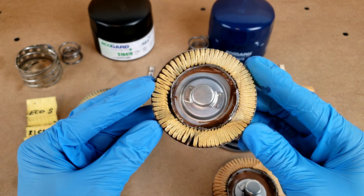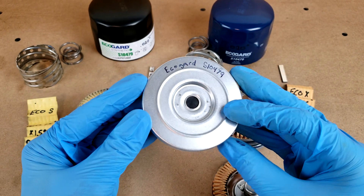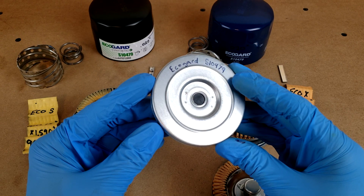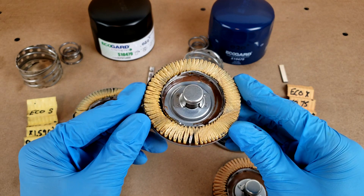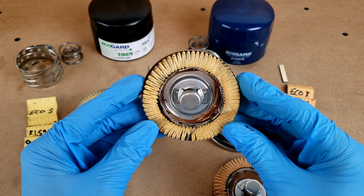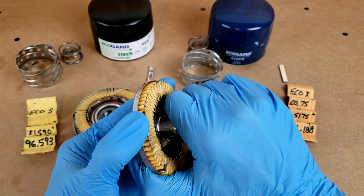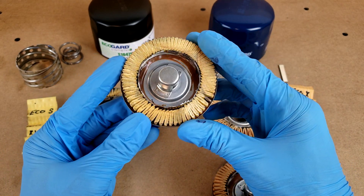The three-piece pressure relief valve is pretty simple — just a stamped piece of sheet metal retaining a coil spring, with what looks like a hard plastic seal on the inside. I've seen some with rubber seals that I like better since rubber conforms best to block leakage, but since the valve is meant to open, a hermetic seal isn't really that important. I like the simplicity and robustness of it — it feels like you could hit it with a hammer and it'd be fine. The only failure mode I could envision is if the tack welds had issues, but this particular filter feels solid; I tried cranking on it and I could feel the end cap flexing before anything else.